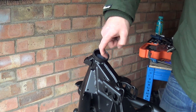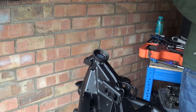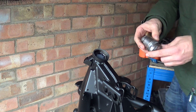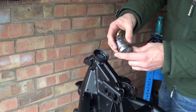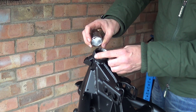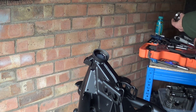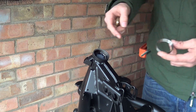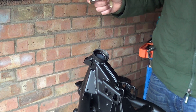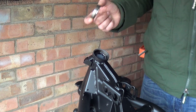What you're going to do is smear a light, light, light coating of 3-in-1 oil in with your finger. To install the race, what some people do is find a socket that's the appropriate size, stick the race in and then just try and knock it in. This takes forever and isn't really brilliant because these sides are parallel and the whole thing needs pressing in evenly. You could use a bearing press, but it's going to be a hell of a manhandling trying to stick this frame under one. That is a better way, however.